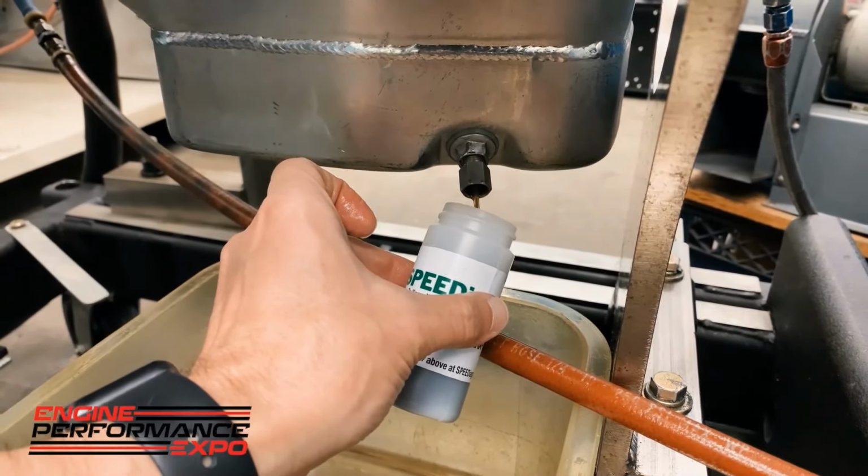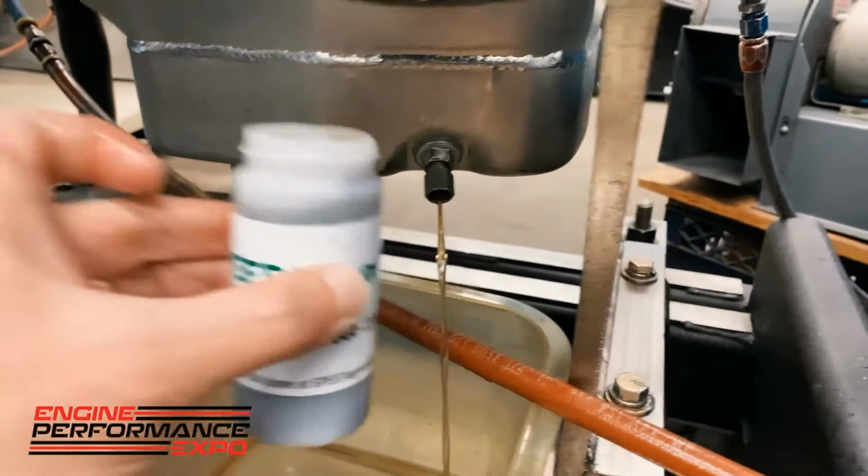If you've got a sample of the used oil from your engine, then you can do used oil analysis later in the life of the motor to know how the engine's wearing and performing. If it's ever anywhere close to that used oil sample from break-in, you know you've got a problem. Could be an issue. Exactly.